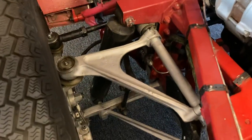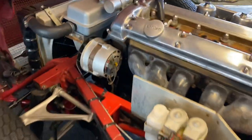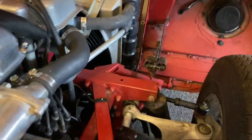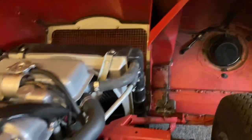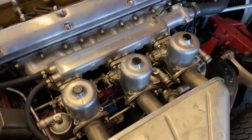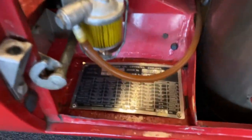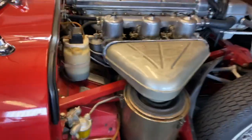One other thing he did was he had painted the front control arms over the years. When I bought the car, I pulled the control arms out, put them in an ultrasonic cleaner, cleaned all the added paint off of them, and put it back together. All the brake calipers are rebuilt. Fuel tank was cleaned out and resealed. Carburetors were already done. All the radiator hoses — basically all the maintenance you would want done to an E-type. There's the chassis plate. I also put almost a nickel finish on the air cleaner box there.